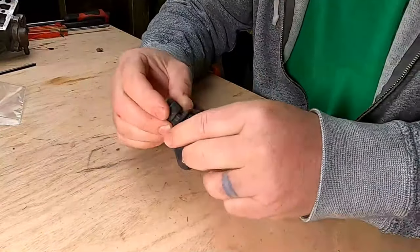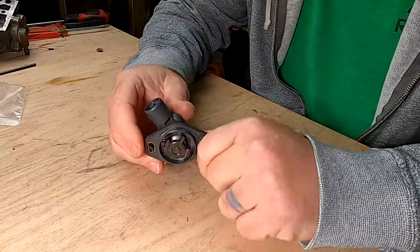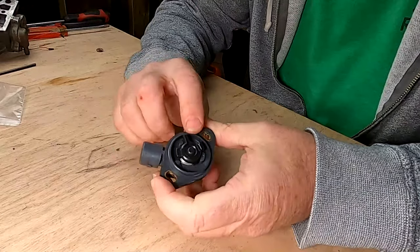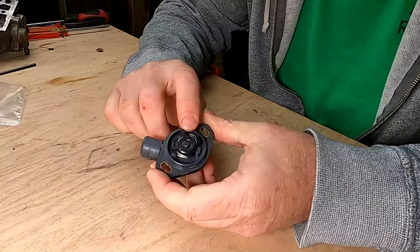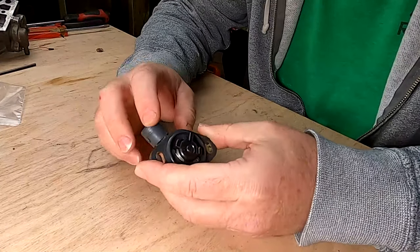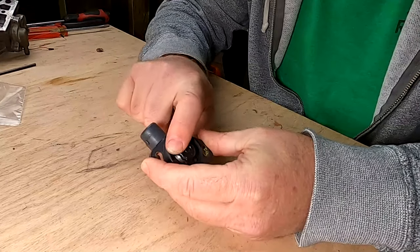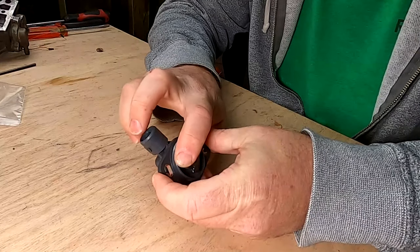Today I'm going to show you the part we're going after. This is the TPS, or throttle position sensor. All it is is a potentiometer — like a volume control. As it gets rotated, it outputs more voltage. This one starts at 0.5 volts, and as you go to wide open throttle, it's producing 4.5 volts.